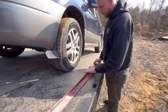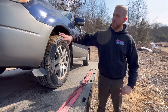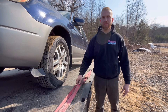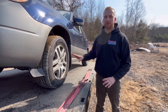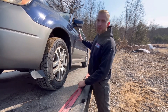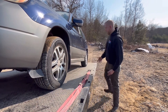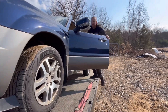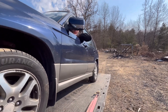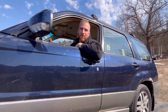We're going to move the strap out of the way. In your case, all four tires would be strapped, so you would unstrap all of them. I always leave the left front as the last one because you are not in the vehicle's way at all if something happens - if it's sliding, you're also close enough to get in and prevent it from going backwards too far. At this point, we're just going to restart the vehicle and drive it off the tow truck.